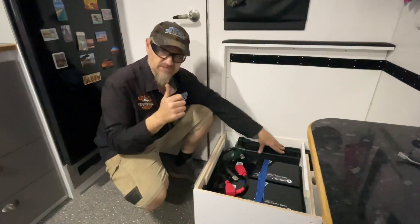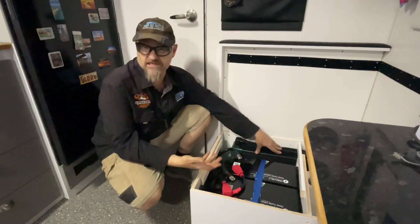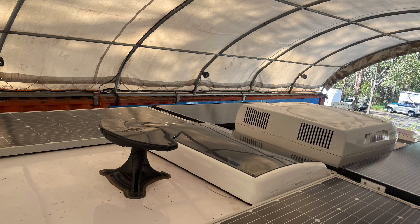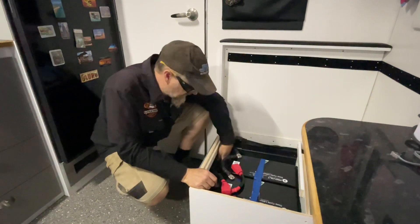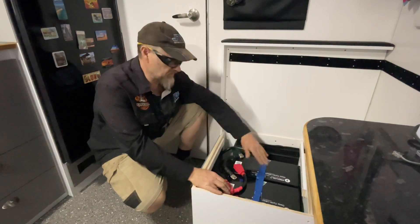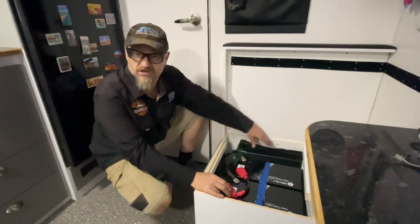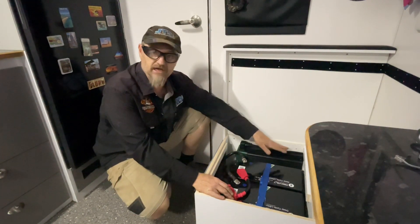The charging system is up in the top — it's a Manager 30, and we've added another DC-DC 1240 to it. The reason for that is so they're going to get better solar output, and also a little bit better charge from the car while driving along. Just down in here we've got the shunt for the Manager 30, some breakers and a large fuse for the 2600 inverter. The 2600 inverter has been wired in by our electricians — InStyle Electrical — and they've certified it, so it's all set up and legal, ready to go.